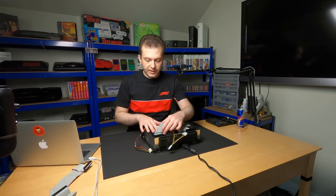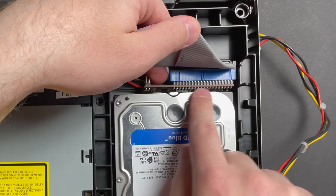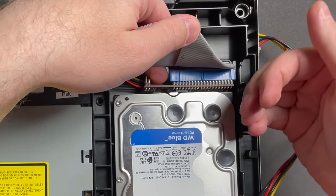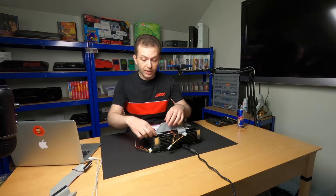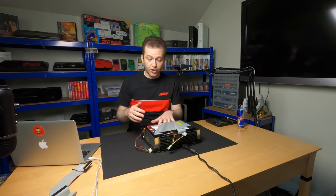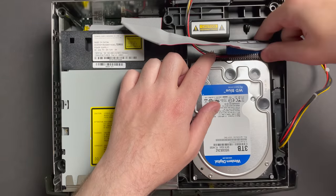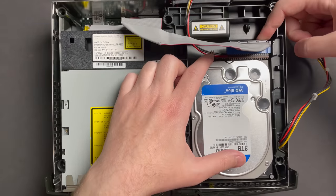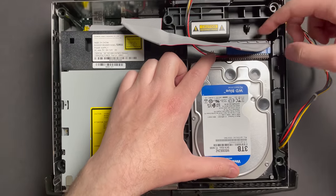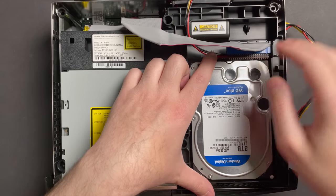Last couple of highlights about this section if you're using a different adapter. Some people are concerned that the pins on the back of the adapter can touch the hard disk and short things out. I've never had that problem with a StarTech adapter. You might have that issue with a generic adapter, but if you want a little bit of insurance, you could just put some double-sided tape on the back of this thing. But as it stands, you would need quite a bit of force to get those pins to touch. That's just not gonna happen naturally, at least with this adapter.